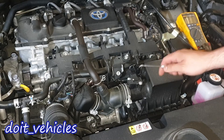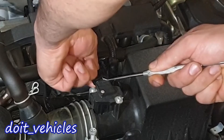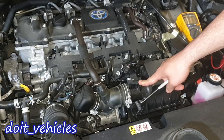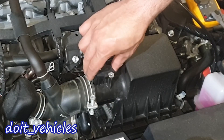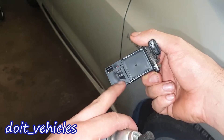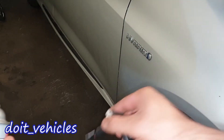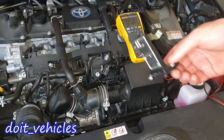On this car we've got the air filter housing here and the mass airflow sensor right here. Let's unplug it. It looks like we've got 5 wires, which means we should have the intake air temperature sensor in the same unit. You're going to need a screwdriver. It's a pretty loose connection — it basically relies on this gasket. It looks like we've got some oil here, so if you want to clean it, you have to use mass airflow sensor cleaner. Let it dry. Inside there we've got the intake air temperature sensor as well.